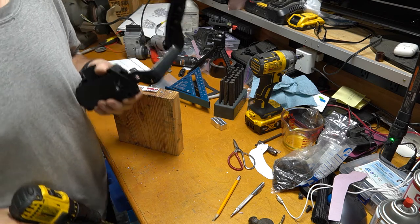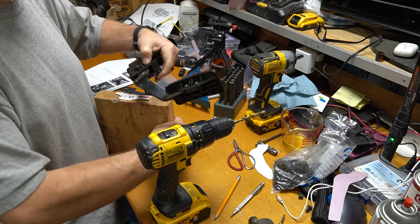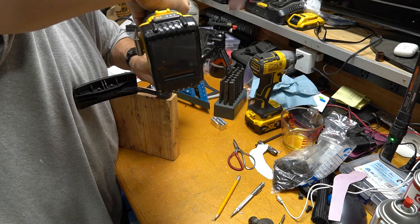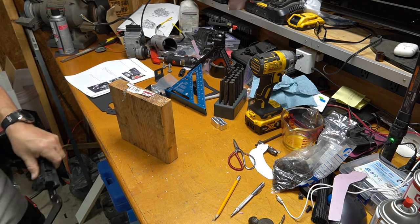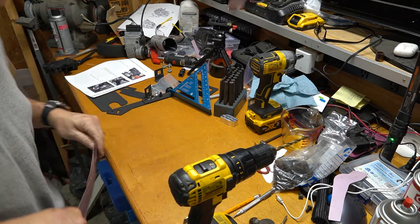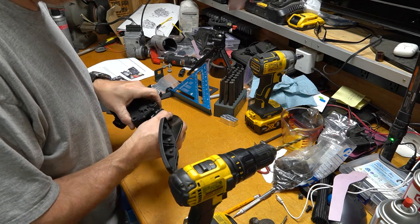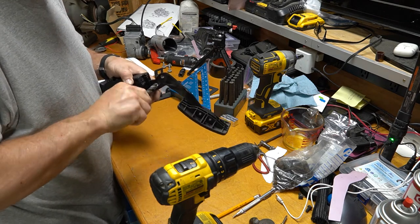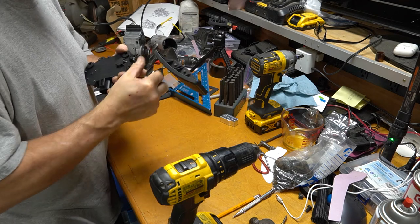That's just awful. I'm going to come from the other side. I've got a little wood on that one. I should probably clean up those edges just a bit because they're pretty nasty. I do not currently have a set of countersink bits, so I just use a bigger drill bit just to take that burr off. One of these days I'll get a nice set of countersinks.